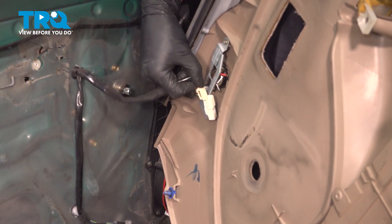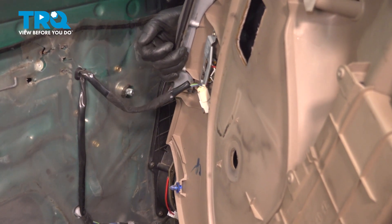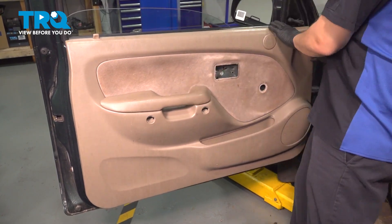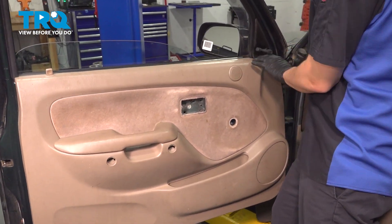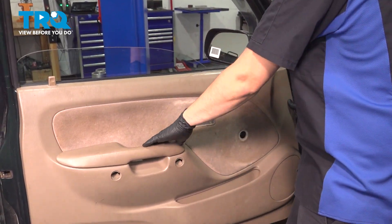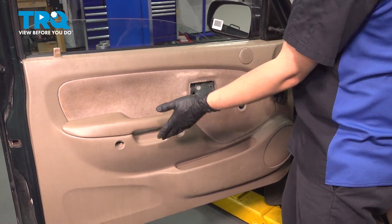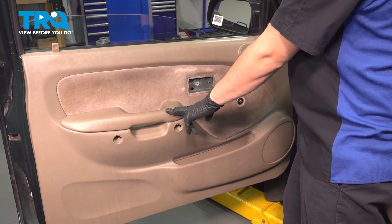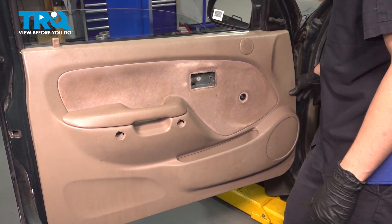Take your tweeter speaker connector, plug it in, and make sure it clicks — if it doesn't click, it's most likely not locked in. Line up the door panel. Make sure on one side it goes over the lock indicator, and on the other side it goes behind and under this little panel. Slides onto the top of the door very nicely. Make sure all of the clips around are lined up — if you tap this in without them being lined up, they will break. They are just plastic, and a lot of times they break when you remove them, so have some on hand to replace them. Otherwise, your door panel is going to be a little floppy.